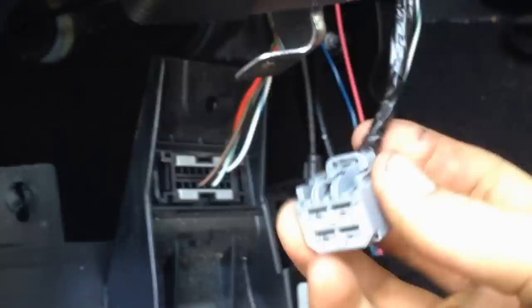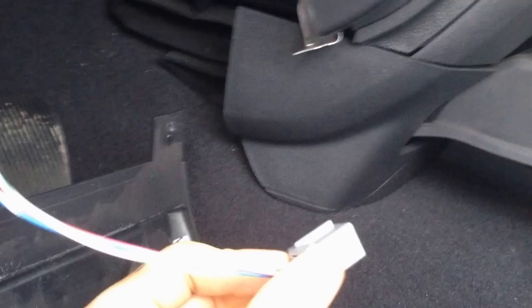A lot of trucks that didn't come with the controller will have this little gray four-prong plug. It'll actually be taped up right around here somewhere underneath — you'll have to untape it. Now, that's one plug, but if you'll notice, the brake controller has two plugs. So I purchased this four-prong plug off eBay — four-prong, but there's only three wires.